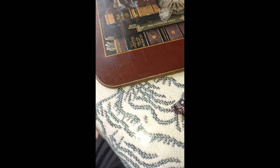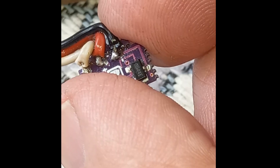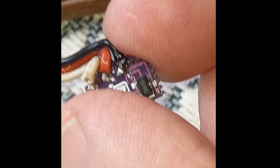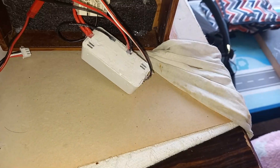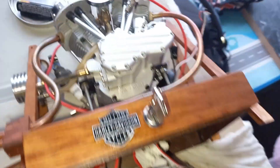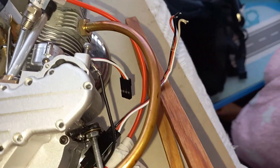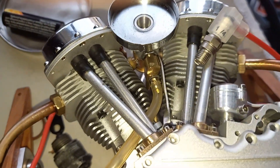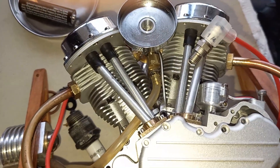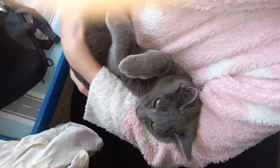I have done tests on the engine. I'm going to show you testing the ignition — it's down there encapsulated with sealer. To check that it still works, I've got the spark plug base up against the metal of the engine and the wires from the old hall sensor. I need to join the black and white wires and see if there's a spark. You can hear it — yes, my ignition is working, so I do have hall sensor problems even though it's brand new. And that sucks. Here's a nice picture of a pussycat to make us all feel better.